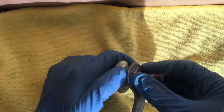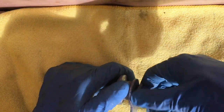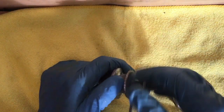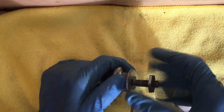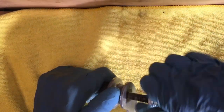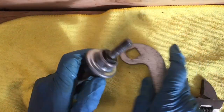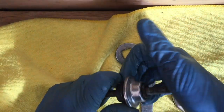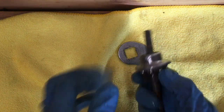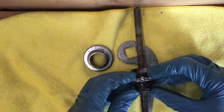We're going to disassemble some of the sub-assemblies. You've got a lock nut, and then the actual brake arm acts as what you would normally have as the cones. You basically just tighten that lock nut right up against the brake arm when cinching it back together, or to undo it, use the brake arm as one wrench and then your outer 7/8s wrench on the lock nut. A lot of times these dust caps are difficult to get off — I ended up just sticking a little screwdriver in there and working it between the bearing and the dust cap, and it popped right off.